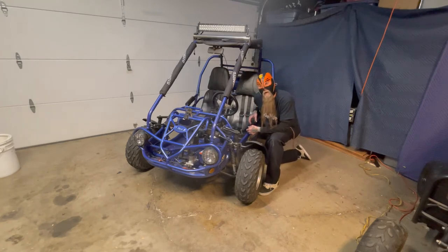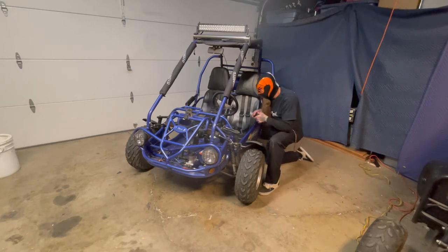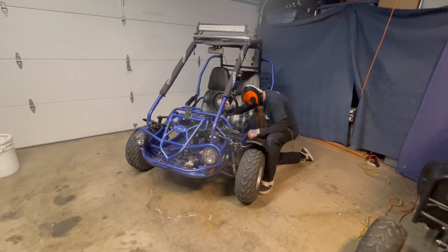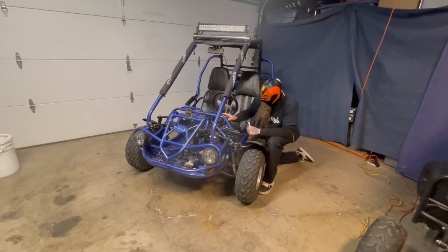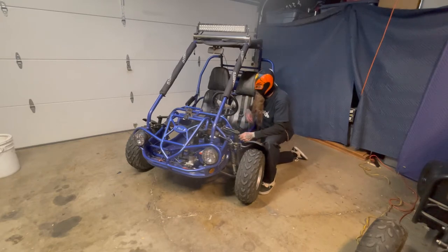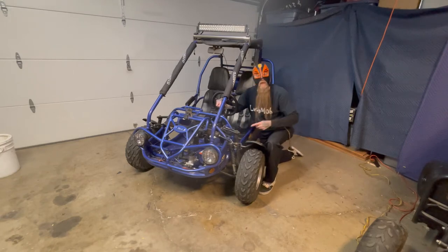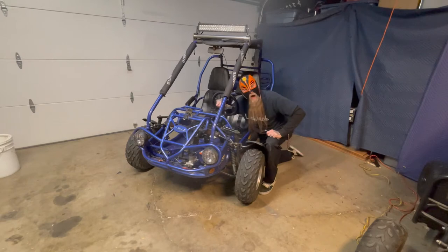So, explain then what you're going to do, Luch. Oh, well, is it me now? Yes, take it on over. Well, we're going to give it the boot. Okay, and explain then what you need to do that. All right, well, we're going to take the steering wheel off, people, and replace the boots on our steering knuckles. And to do that, all you need is a 13-millimeter wrench. And sometimes there's a circlip in here that you need to take off. This time, there isn't. We don't know why, mysteriously, it's not there.